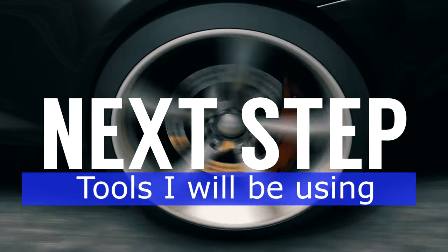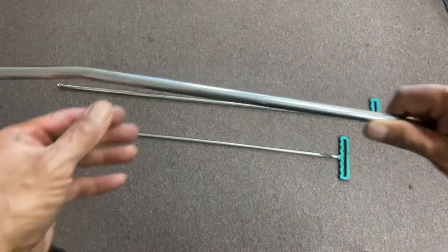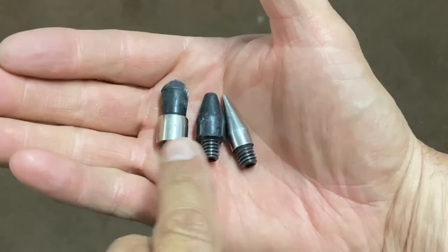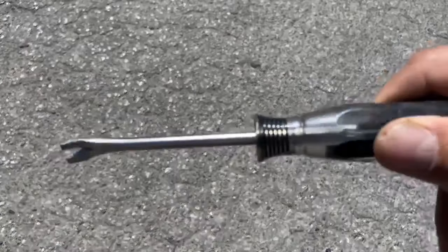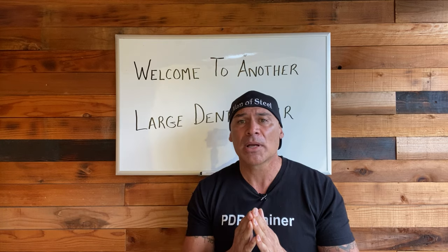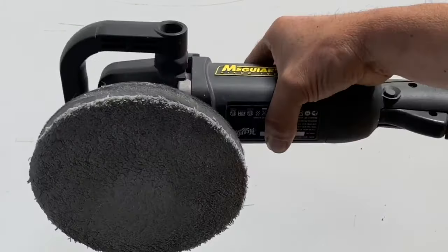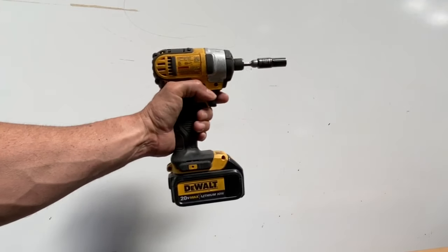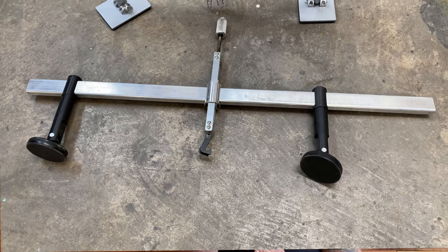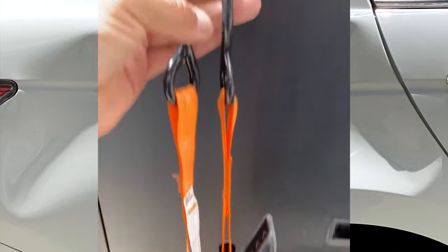The body shops down the street said it was impossible to remove large damage like this without cracking the paint. The man of steel is definitely up for the challenge. Here is a list of tools I will be using: three paintless dent repair rods for pushing, three tips for different sculpting techniques, a nylon clip remover, an auto body slide hammer, cold glue, plastic crease tabs, a glue gun, a polisher for the clear coat, a 10 millimeter and an impact drill, a PDR light to see the damage. And if you don't have a dent lifter, don't panic — you can use different types of straps and cables to pull the damage.